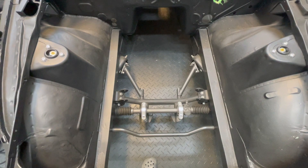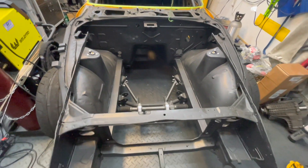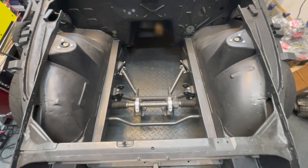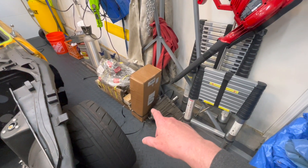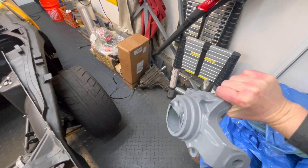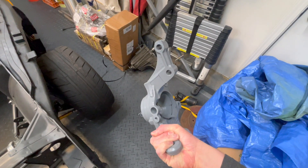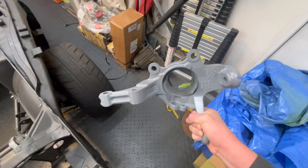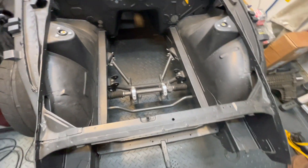For the front, I'm going to be running parts from an early 2000s Nissan Maxima for the front-wheel drive setup. We're going to be changing a few parts here, and it's going to be interesting. I got some BC coilovers for the Nissan Maxima, and I have these knuckles — front hubs, really — that I got from a junkyard from a Nissan Maxima. I've painted them up. I think between these, some custom shafts, making those coilovers fit, and getting the steering to adapt to it, it could work.